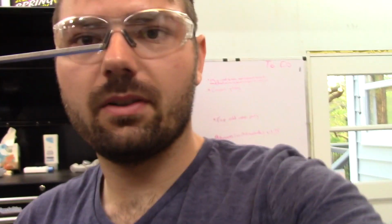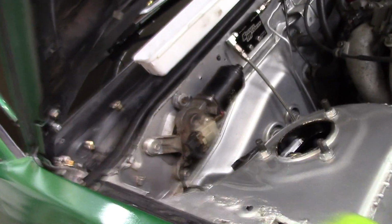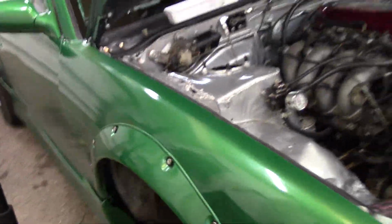But a happy medium. I think it'll be okay if you just put, I think this ratchet goes to like 35 foot-pounds. When I made those marks, I was probably taking this to like 100 foot-pounds or something crazy. So just be mindful of that when we make the camber adjustment, but I think we're pretty much there. So that's the point of them, and that's the test fit. We get in alignment again later this week, and hopefully we can get that negative camber dialed. That's kind of my last little revision upgrade for the year.